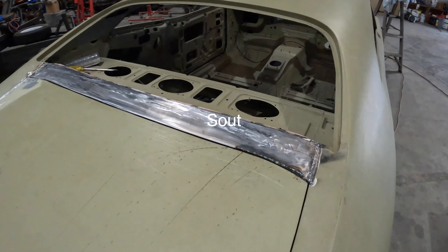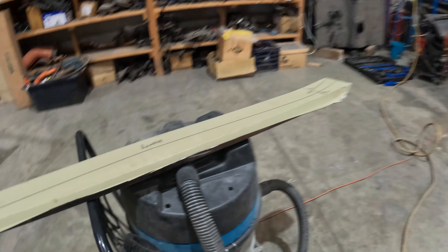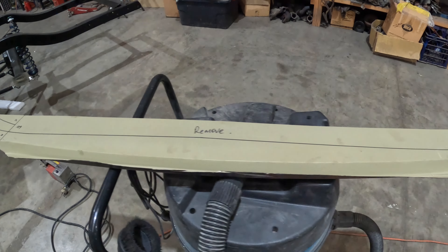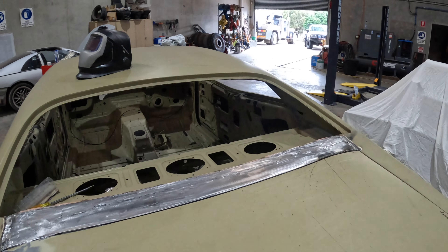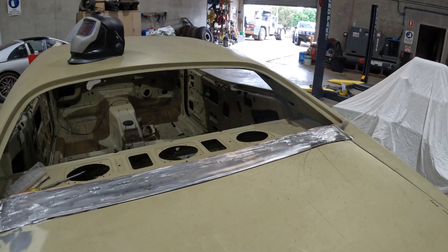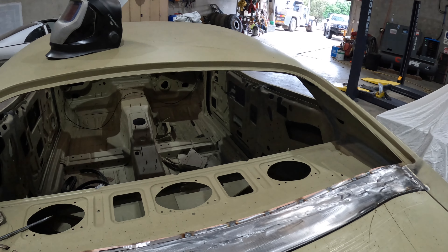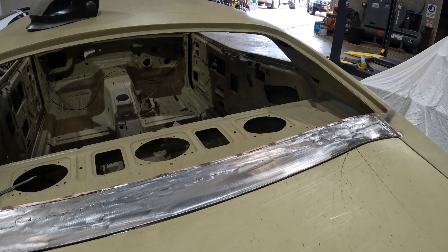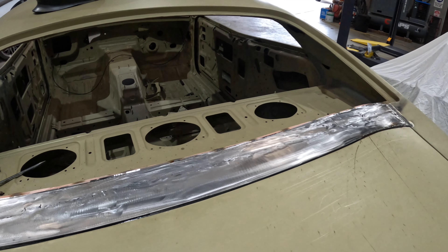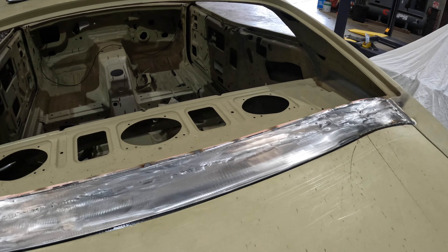It turned out really well, but my work on that panel just didn't seem right. So this is the original one — I ended up deciding on ripping it out. This car is going to have a flush fitting rear screen, same as the front screen, and that meant I ended up pushing the screen up hard along the top, which meant having to add a little bit of metal. So this whole panel is roughly about 25mm higher than an original one.